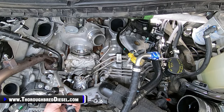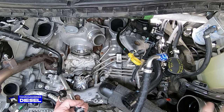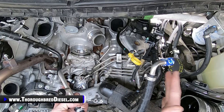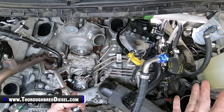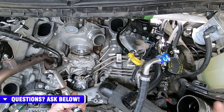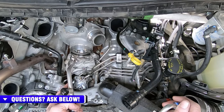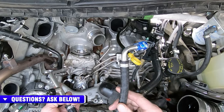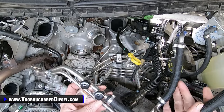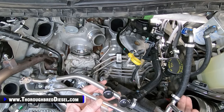I'm going to unhook the GoPro and I'm going to take you back there and show you where it is. The foam isolation panel that goes over it on these new model trucks of 20s and up, the push pins on them are rough to get to, for lack of a better word. I can make do with one of the pins out to get back there to that return line and unhook it, because it's just a normal everyday quick connect. And I'm going to show you that again. I'll take the GoPro out and I'll show you that. So this is return, this is the pressure side. You get this new line kit, this engineered line kit that is engineered just for the DCR.